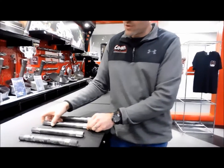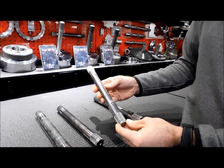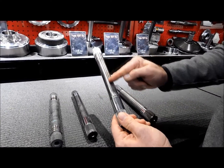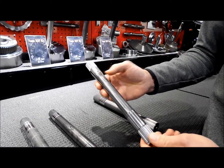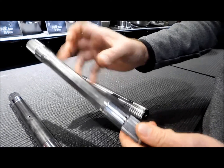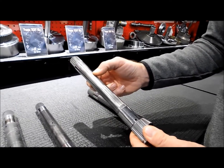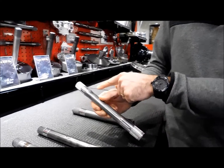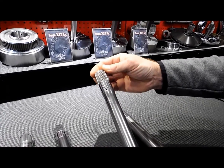The next step up is what we call our Torsional Super Shaft. Again, we're using the aerospace alloy, but we've made some additional geometry changes to the shaft. Still utilizing rolled splines, so no undercuts on either end. But in this instance, there are no oil holes in the main barrel diameter of the shaft — all the oil holes have been positioned close to the journals, with an additional oil hole added to provide more oil to the sun gear at the rear of the transmission. We term this the torsional shaft because the main barrel of the shaft has actually been reduced in diameter and strategically designed to add torsional compliance in order to reduce stress that would typically lead to failures at the oil holes — essentially designing twist into the shaft to keep it from breaking.